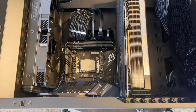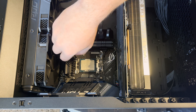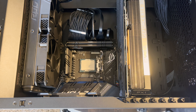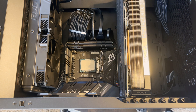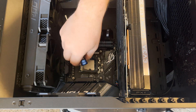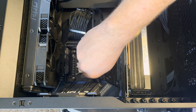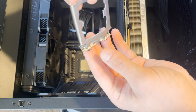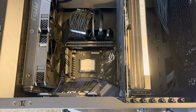After you get all four screws threaded, it's important that you don't just wrench down on one side and then the other. You want to do it probably a quarter or a half a turn in a diagonal pattern until you feel a positive stop and then it's installed. What I mean by positive stop is you'll be turning and turning and then you'll feel a little bit of tension and then it will just stop — it won't want to go anymore. If you have it too loose or too tight, the CPU or the motherboard might think there's no CPU in there and your system just won't boot. Or if it's pretty tight but not tight enough, the system might still boot but the CPU is loose, and then you run into issues with shorting things out. Just push everything to the positive stop and that should be more than enough.